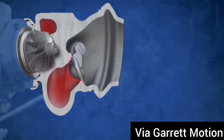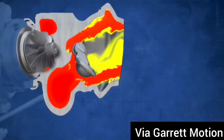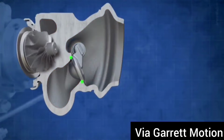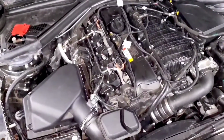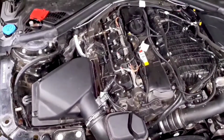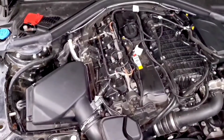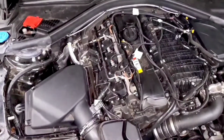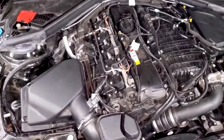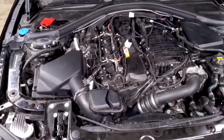When you look at your wastegate duty cycle, 0 means that the wastegate is completely open and just bleeding off pressure. 100% means the wastegate is slammed shut and building up as much pressure as possible. Usually you'll see wastegate duty cycle go to 100 initially to help boost build as quickly as possible, and then it'll begin to reduce a little bit so that it can hold a set boost pressure while you're going through the rev range.